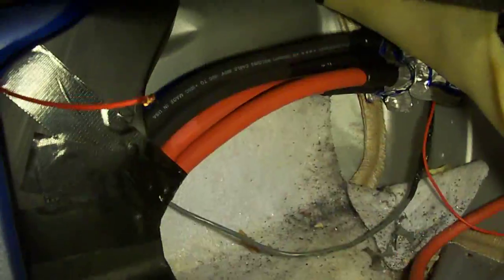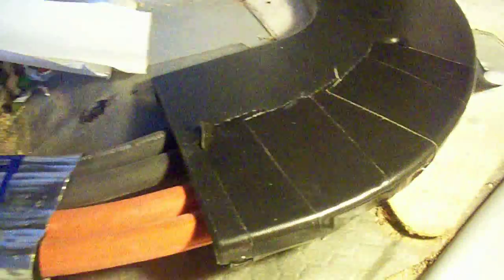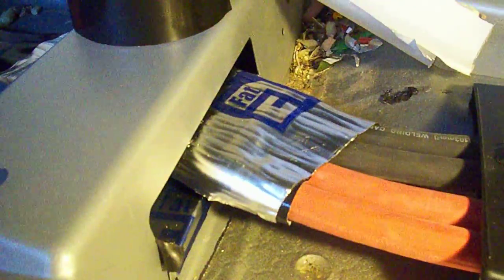Here's what I did to run this all the way to the back with no issues. There's basically a factory air duct that runs through this brace and is for blowing air on the rear passengers' feet. I just cut a hole in that for all the wires to go into, then ran the new wires through the factory air duct. I took off an extension piece that was in there and put the wiring through there instead.